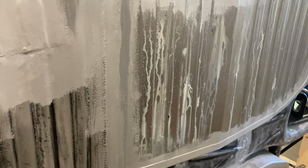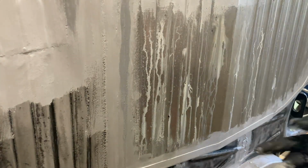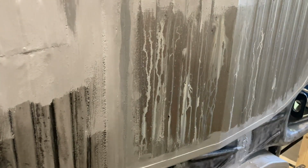There's no roof on the car, so if it's pouring out and I'm driving the car on the street, the whole car is going to get soaked inside and out anyway. So really sealing this pan off is more, I guess, for aesthetics. Maybe it'll stop moisture from getting into the seam and kind of blowing it out because it's obviously not primed between these two pieces of metal. So that's kind of my main reason for doing the seam sealer on it.